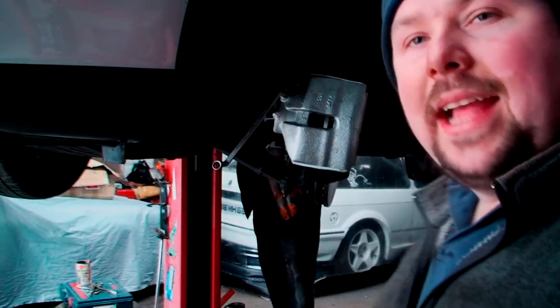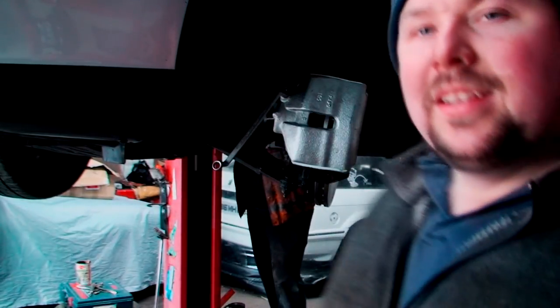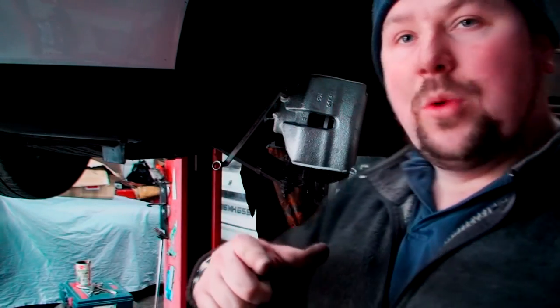This could be difficult. Basically, what John is doing now is inside the car. Well, as you can actually see, he's technically not. He's pressing it with the bar, but you get the idea. If you jump up, John, we can't see your legs, and then we might be able to get away with it. So what he's going to do is put pressure on the brake pedal, and I'm going to open up the bleed nipple, and then the pedal goes all the way down. But obviously the fluid will come out.